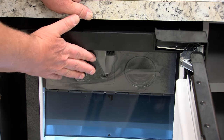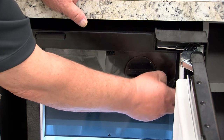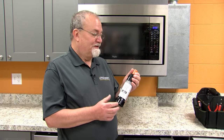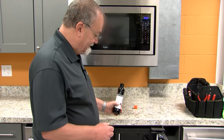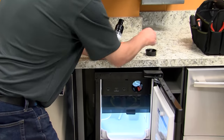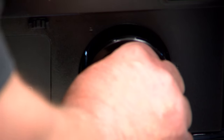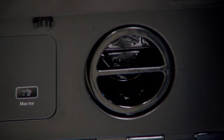This face also has a protective film. Grab it at a corner, remove it, and discard it. Next, we're going to install the water filter. Remove the top cover of the filter housing and remove the cap that's already on the product — set that aside. Now insert the EveryDrop water filter, push it in fully, and twist clockwise as you push it in until it seats. And you're done.